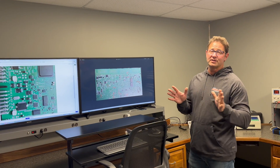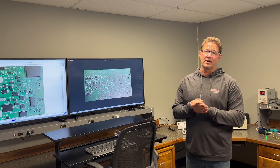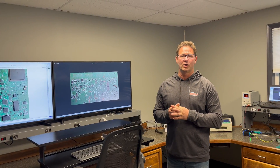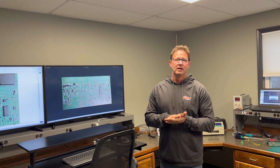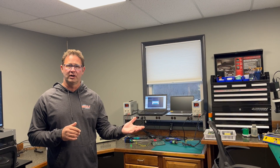If one of your CPCs gets stolen out of one of your trucks, we can fix that — we can give you a replacement programmed to your truck. We can flash stuff here. I'd say 90% of the time we can send you a CPC fully reprogrammed, plug and play. From time to time a job comes in where the data is gone; we can either program it, which is a little bit more of a charge, or send it back to you and have it flashed to your truck.